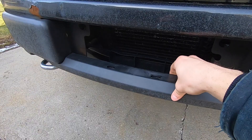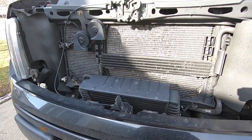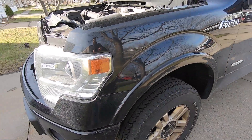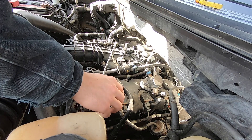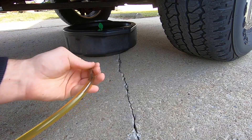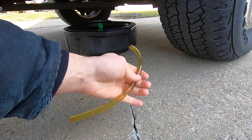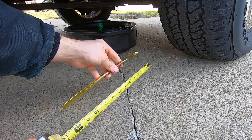This bar right here, guys, it's plastic but there's metal underneath, so you can step right on that to get into the engine bay, or obviously the wheel well. Take your oil cap off. I just like to set it in there like that so it can vent. And now we're going to go ahead on the bottom and I'll show you that Fumoto valve — 5/16th inch diameter hose to put on the Fumoto valve, about a foot long.